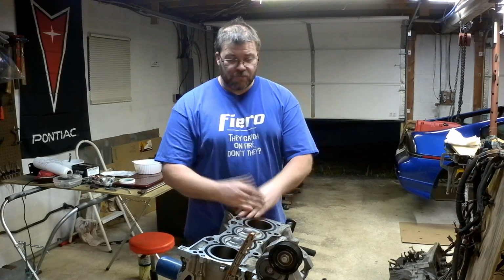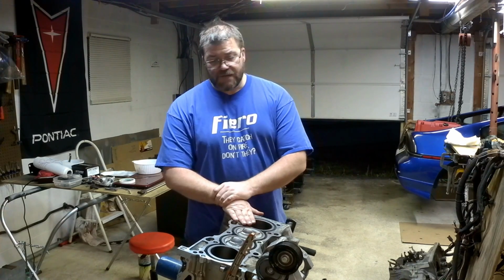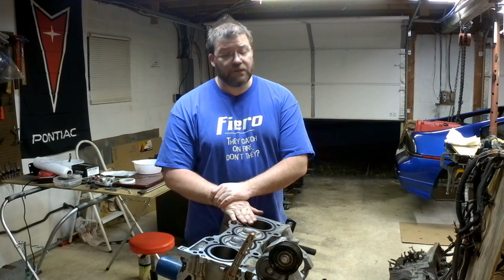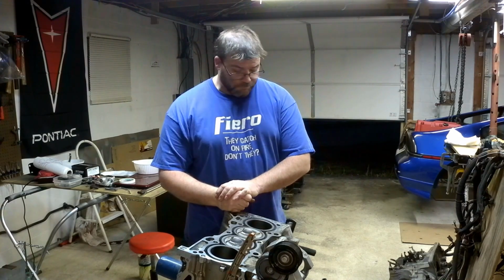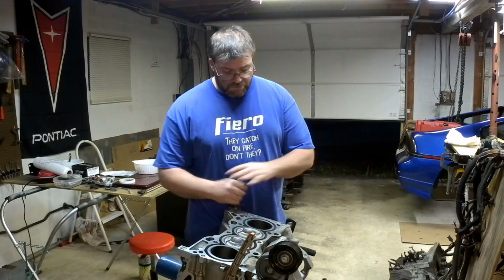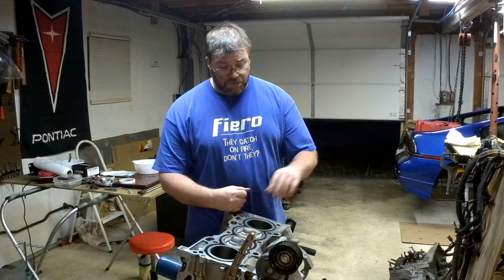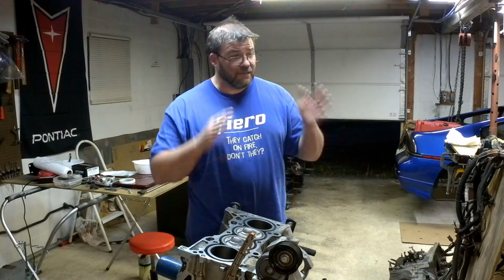Now you might be asking yourself, why are you going backwards? Well, simple fact is, as I stated earlier, I found some grit in the intake manifold when I removed it to do some media blasting to kind of make it look nicer. So, turns out that the engine did have a bit of grit inside. I went and Scotch-Brighted it with some WD-40. Once I'm done with that, well, I am done with that, but I don't have any ATF.